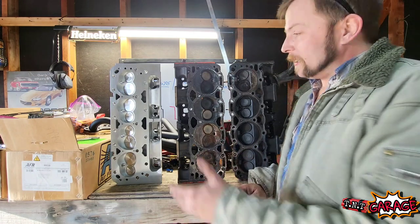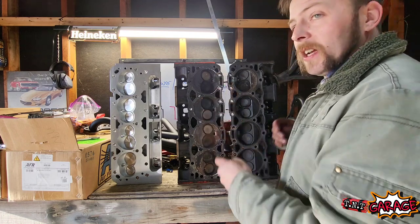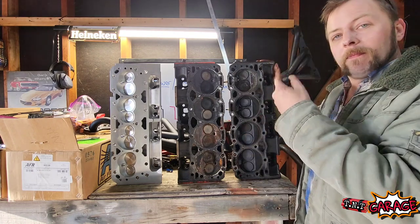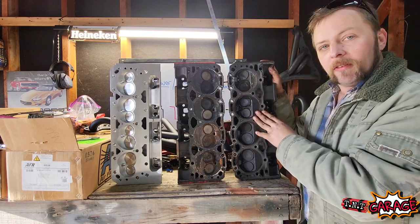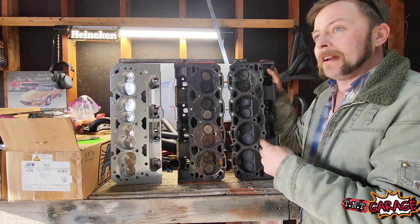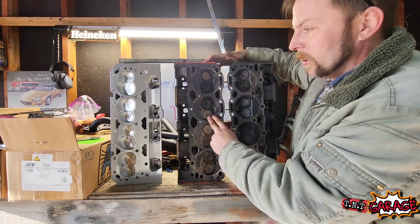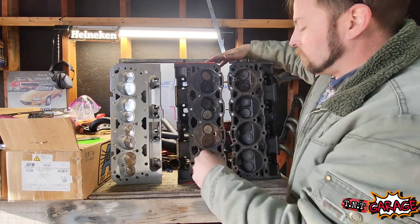All right. Well, I jammed the head off of the Vortec 350 for my son's truck. Even comes fresh with a spider in it. A dead spider. Now, going from right to left, we've got the LB9 TPI 305 head, which is slightly different from a swirl port head that would come on like an LO3 305. You have the L31 350 head for a Vortec, and then we have our AFR 195 Enforcer head.